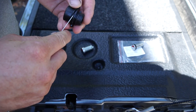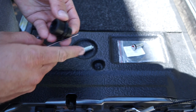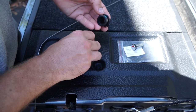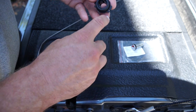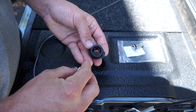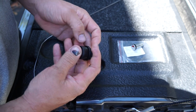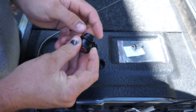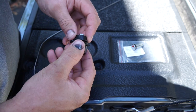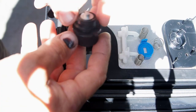There's an O-ring there that stops water, dust and everything — there's an O-ring at the back as well. Once you've got it out, put the new one in. They only go one way: tabs at the bottom and the red at the top. Push it in and you'll hear a click. Make sure the O-ring seals and then you're done that side.